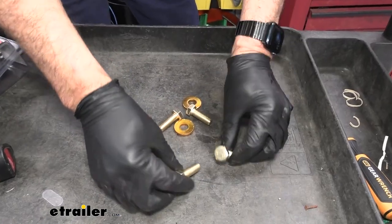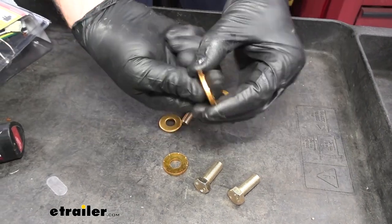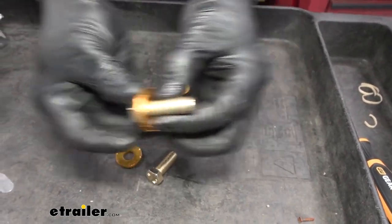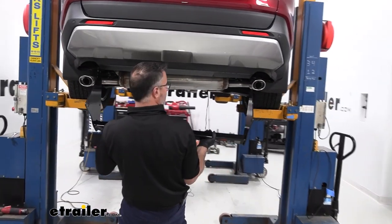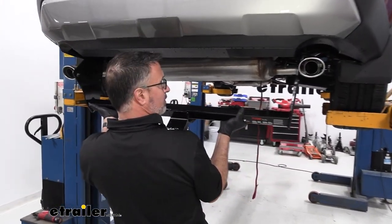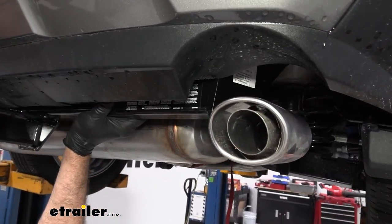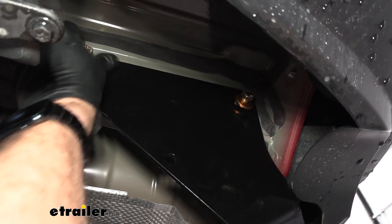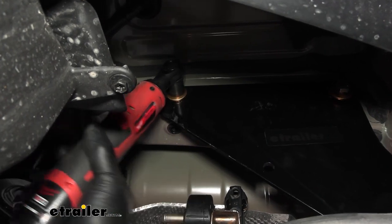Go ahead and take a look at the hardware that comes with the hitch. You're going to have metric 10.9 cap screws and conical teeth washers. The teeth are going to go towards the hitch, and this gets bolted into the frame rail. Let's go ahead and get the hitch up into position — just come to either side on the inside of your exhaust here. It'll go to the outside of the frame on either side. We're going to go ahead and run these down now. I have a 19-millimeter socket, and we'll just snug them up on each side, then we'll torque it to the specs in our installation manual.